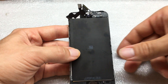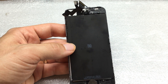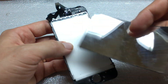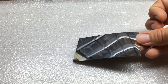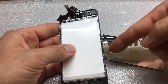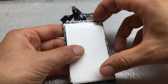Now next we have our first piece of the backlight. This is the reflector sheet, and it's called the reflector sheet because of the shiny, mirror-like finish. The purpose of this finish is to reflect all the light of the backlight through the front of the screen — you don't want any light escaping out the sides or the back.